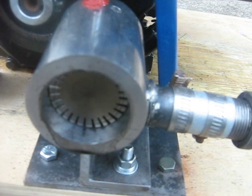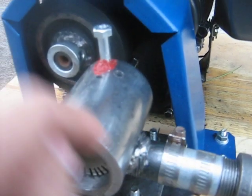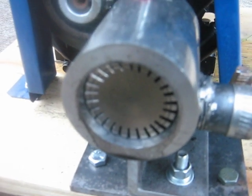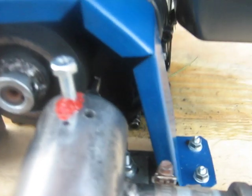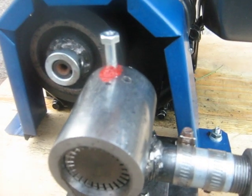The exhaust feeds into the back of the turbine housing. One of the problems I've been having is turbine end play — you can see that little shaft collar there keeps loosening up, in spite of the fact that I seriously tighten it. I think it's just because it gets pounded by the exhaust on a one-cylinder engine.